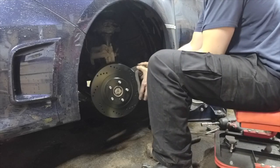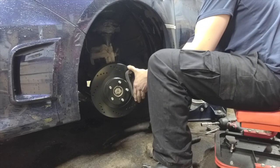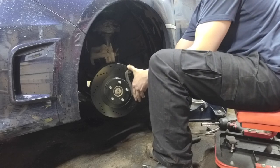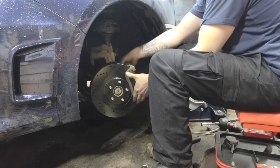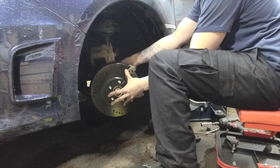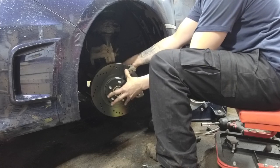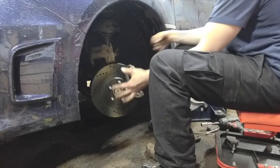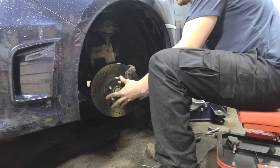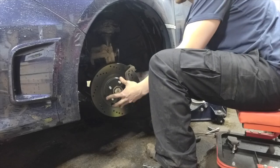So I'm going to ask the question because we've had this conversation before. The clips, what are they like? Because usually when you buy aftermarket brakes from, say, your local UAP, you're asking for the fit and fitment of them? Yeah. Did they clip in really easily, or did you have to heavily modify them? I didn't have to modify anything. I had to clean a lot more of the rust off the brackets, which is understandable anyway. Once I cleaned the rust out, they just clipped right in. So, perfect. Good job, Max Brakes. We'll see how the pads fit in now. That's the next test.